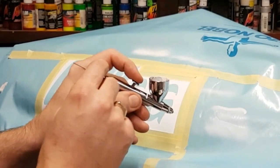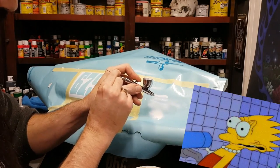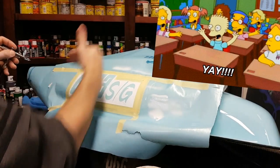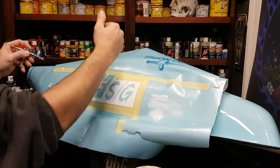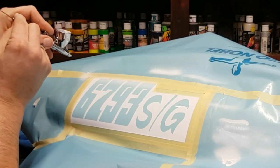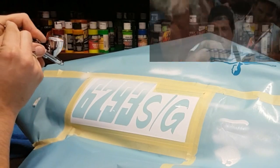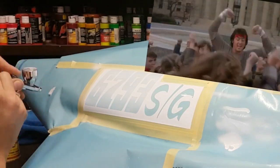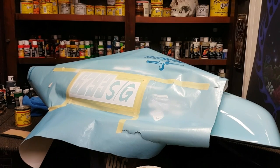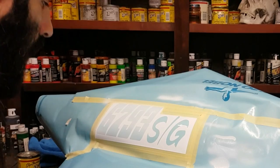For big areas I like to pull back on just the needle, push down for air, and pull back — that gives you a little bit more paint. Be careful you don't pull back too far. The 50/50 rule: starting from the top down, overlapping every pass by about 50%, low and steady. I'm about four inches away. I've got my wrists locked, elbows locked, and I'm swaying my whole body from side to side for a nice consistent pattern. That went on way too wet — we're going to let that dry before adding any more paint, and we're going to thicken up this paint as well.